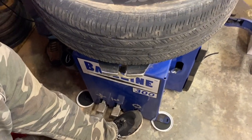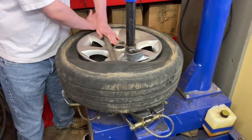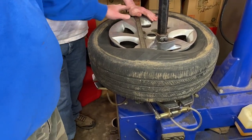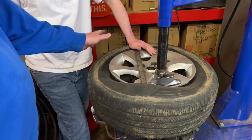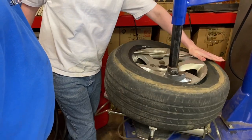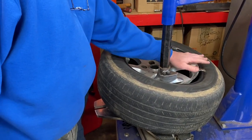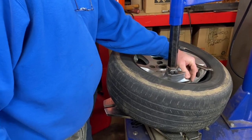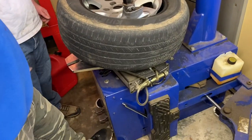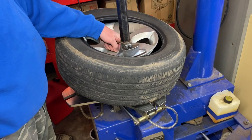What I'm going to do is go ahead and let you hold this. Come around here, Nathaniel. Let's take this hand away from here — we don't want to have a hand near any of this. But just keep a hand right over here on that arm. Take your foot and push that pedal. Watch the machine — it's going to take that tire off of there. There you go. Whoa, stop. Don't ever get your hand anywhere over here near this. As that comes around and this tool starts moving that way, you let go of that tool before you ever get your hand anywhere near this arm. Now let's take the tool and spin this tire all around again to where our valve stem is right here in this area, because we're going to take this other bead off of here.